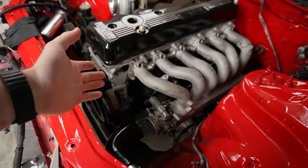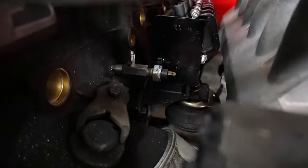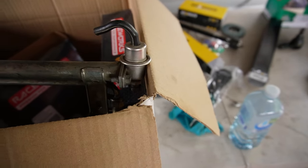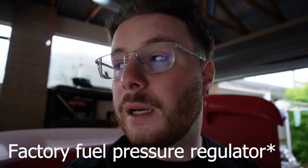You can't really see it because I've actually bolted up the ED plenum for good. I had an intake manifold gasket laying around so I thought why not just chuck it on whilst I had the time. I ran into an issue with the fuel rail - the stock fuel pressure regulator is bolted onto the back of the factory fuel rail and I can't use it because it'll starve the engine of fuel. So I had a look and Raceworks actually make bolt-on ED fuel rails for these cars, which is perfect.